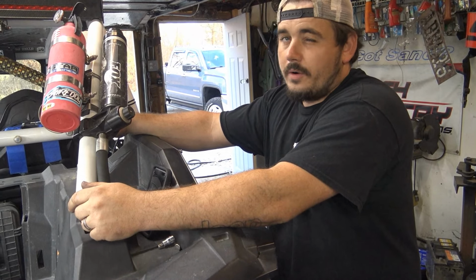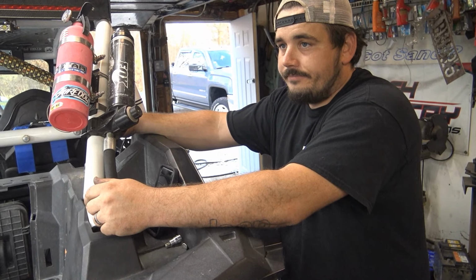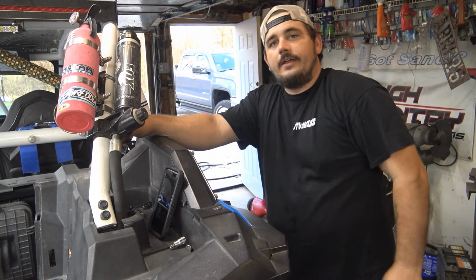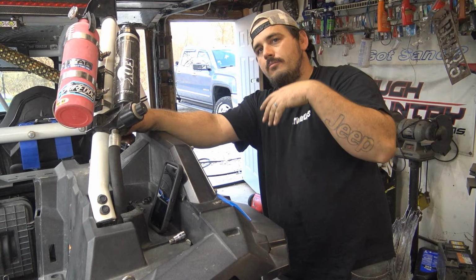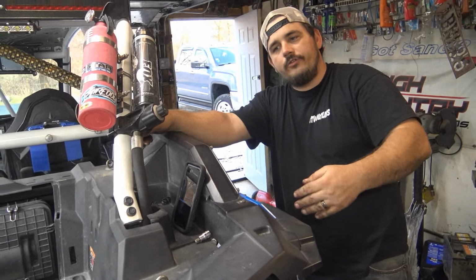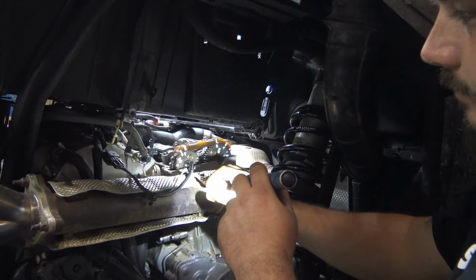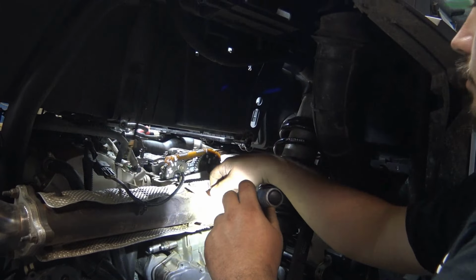And now's the point where we're going to rotate it counterclockwise. And, I don't know, it'll probably be 6 or 8 revolutions. And you'll see it come back. You want to see your timing marks hit more than one time. Now, if you rotate it once and you see them, and then you rotate it again, you don't see them, that's normal. All right, so we've rotated it 50 million times. It's just something you want to be very sure of.